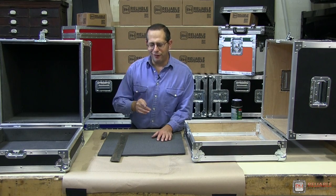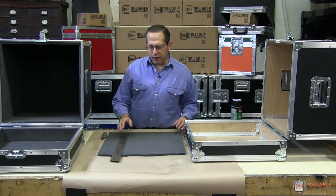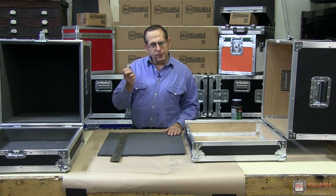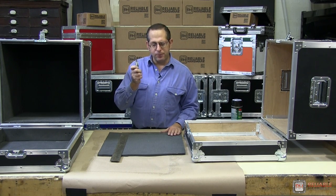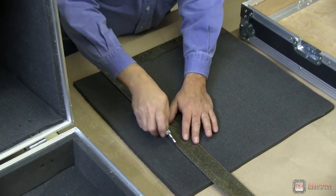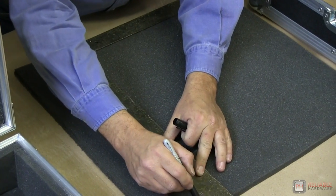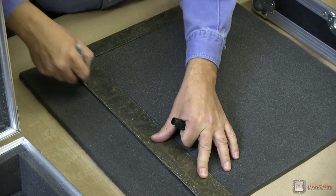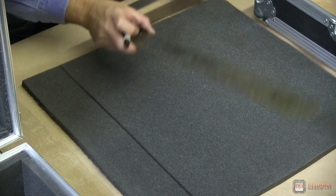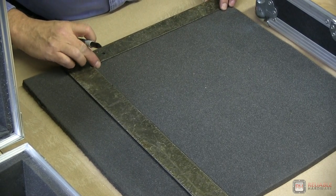Just make sure you get it back before Turkey Day. To cut your foam or carpeting, we recommend that you use a square or a straight edge and a good, sharp utility knife — this will get the job done. You can either run your blade right along the straight edge and cut it, or if you're pretty good freehand, you could mark a line along your straight edge and cut it that way, or you can do both. I prefer to use the straight edge as a guide — it'll keep your cut much more accurate.